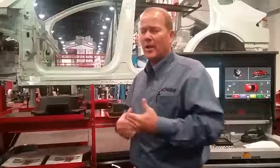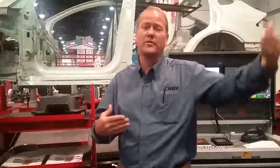The real advantage of having this in a collision shop is that most collision shops send that work out. They get put in a line, and depending on where they are in that line depends on when they're going to get that vehicle back — it may take 30 minutes, an hour, half a day, or even into the next day, especially if there are any bent parts. Well, if you do the alignment up on the rack, you're going to identify any bent parts and get those ordered before it ever gets to the paint shop. Now that vehicle can cycle through in the time it was designed to, customers get the vehicle when they were promised, and we don't have any delays — it helps with the cycle time for the shop.